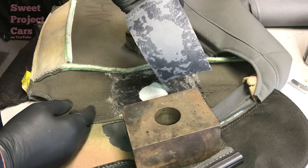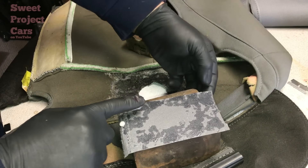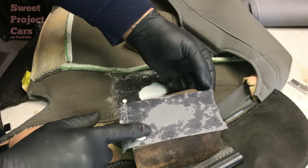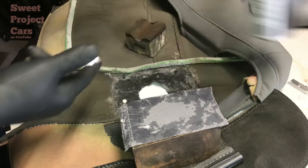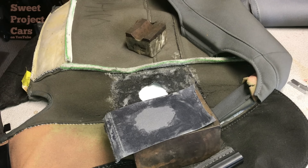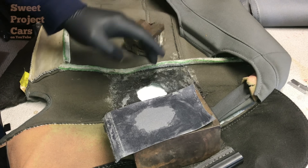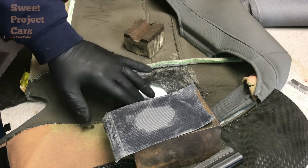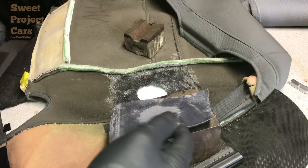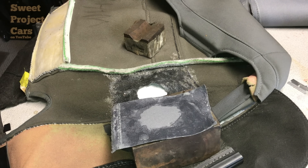Peel it up and look at that — you've got a perfect circle with no glue in it. Spray a little bit on your rubber glove and rub it into the areas on here. You can also put it in a spray cap and use a brush, but that's the nice thing about these gloves. Just let that dry up a little bit and then we'll stick it on. In warm weather it'll set pretty fast. Check it — if it starts getting tacky, you know it's ready. Spread out any of the wet spots. You can clean it off with a little rubbing alcohol or lacquer thinner. Give that a minute and then we'll stick it on.